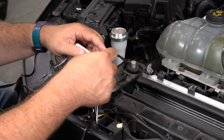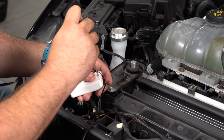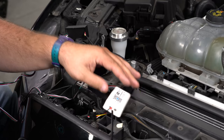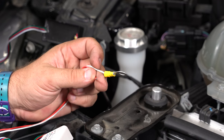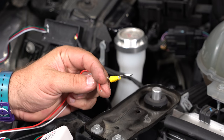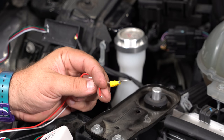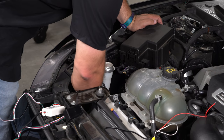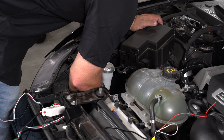The negative goes in here and the red goes into the positive. These two connections on the other side of that harness are going to power the controller. The ground — the white wire — is actually going to go to ground, anywhere metal on the car. The red wire we're going to tap into our headlights. You can also put the red onto a switch so you can power it by a switch. In our case, we're going to plug into our headlight so it's powered by the headlight, since we can turn it off with our WiFi controller. You can actually reach into the headlight and find the harness, then unplug it and fish it out.